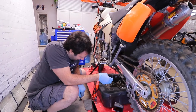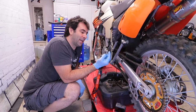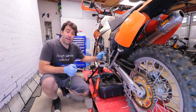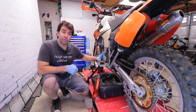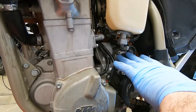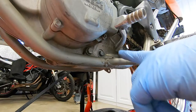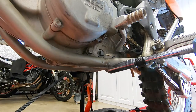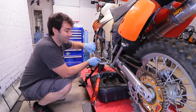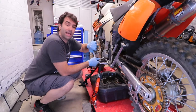The oil is pretty dark and there is quite a bit of fuzz around the magnet — I'm gonna clean this up. Moving on: the KTM motor also has two oil filters and two screen filters. The first screen filter is over here and we're going to remove it and replace it. I'm gonna replace everything I can today.